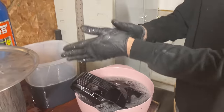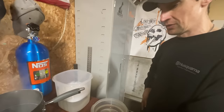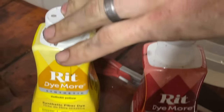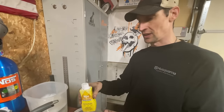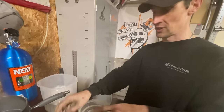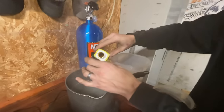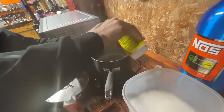The black plastics are done. Now we're cooking a different color — orange. The orange dye is kind of a transparent color, so I like to mix yellow and red. When mixing colors, best to get a clear container and do a test batch — mix a little bit of two colors together, get the color you want. Orange is basically a lot of yellow and a little bit of red. You always want to start light when doing any color besides black, because if you dye something with too much blue it'll turn black.